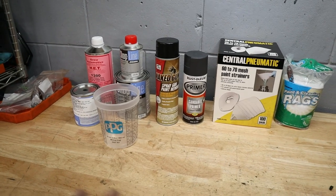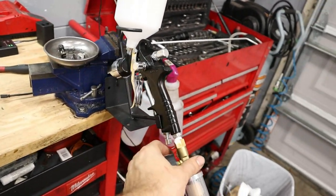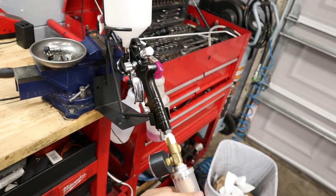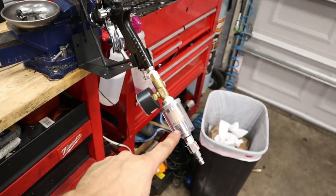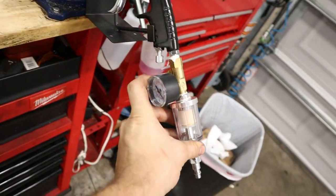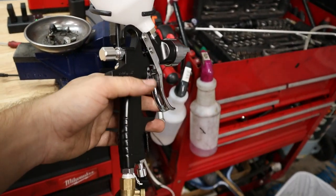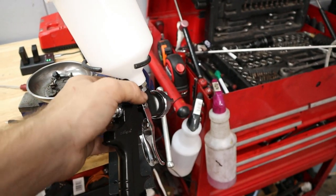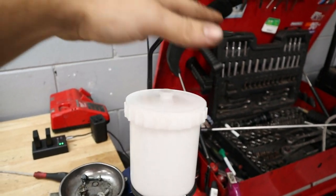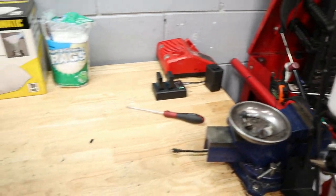So right here we have everything that we're going to be using today to paint, including my gun here. I'll put a link to this one in the description below. It's from Amazon. It's a very budget-friendly gun. I think it's like under $50, but you do need to combine it with some other parts like this air-water separator right here, and also a pressure regulator with a gauge right there. But otherwise, it comes as a complete gun with a 1.4 millimeter nozzle for spraying here, and also this hopper. But this loading carriage I had to buy separately. This was like $12 at Harbor Freight.